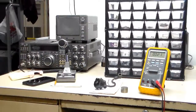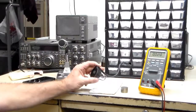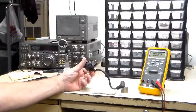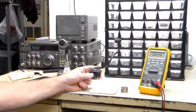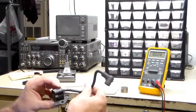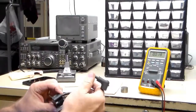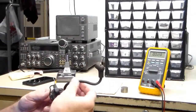Hello everybody, it's Tim again. Today we're working on a McCulloch Chainsaw — it's a relic, from 1990-91, that era. What I have here on the bench is an ignition coil from a similar chainsaw, and I believe that's the problem with the one I have. The actual problem with the one I'm working on right now is the wire for the spark plug — everything is just destroyed from all the heat from the engine and the oil.